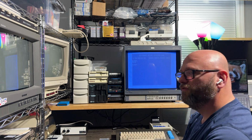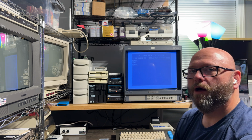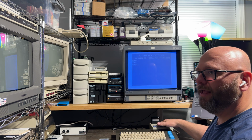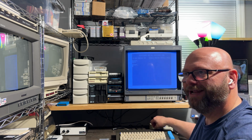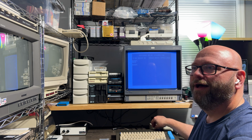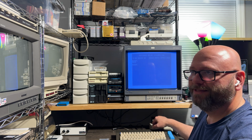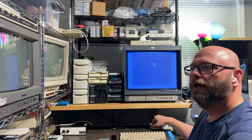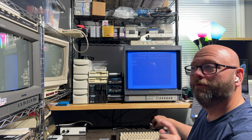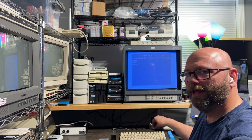There are really three different types of RAM that you can use with a RAM link. The RAM link has a RAM card internal to it that plugs into an internal port. That RAM currently has 16 megabytes, and that's the limit, 16 megabytes. It comes in the form of SIMMs sitting on that RAM card in the RAM link.